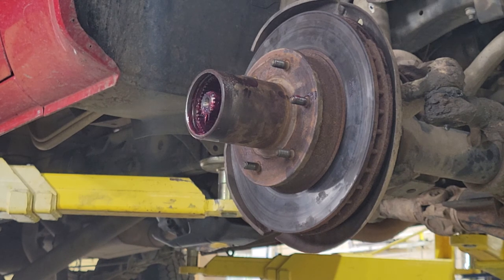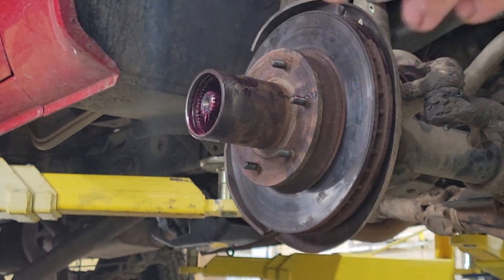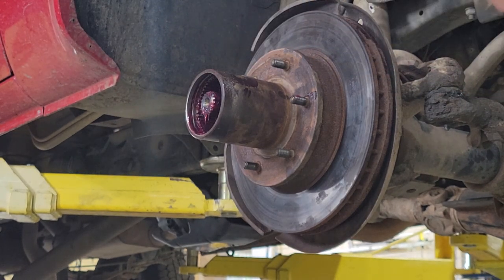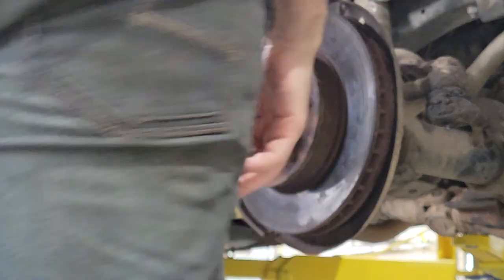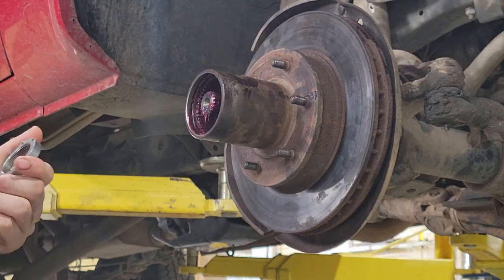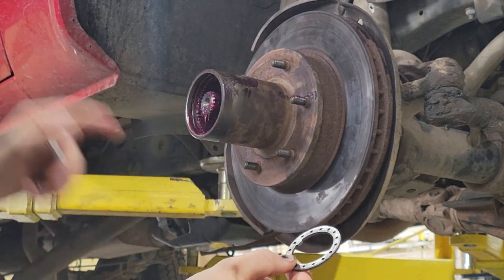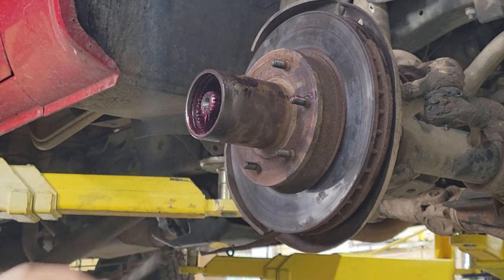Okay. Got your two spindle nuts. This is the one with the pin. I don't know if you can see that. I don't trust my phone's focusing ability, but there's a pin on one. Pin facing outward. If you stick that pin inside your bearing, you are in trouble. So, it sticks out, and it does that so that it can slide into one of these holes, and it's got a groove that sits on the actual spindle to prevent it from continuing to spin.